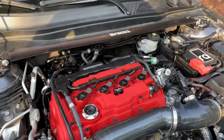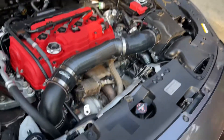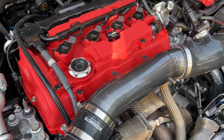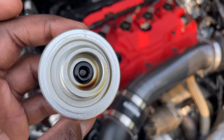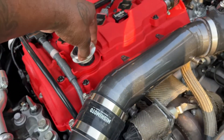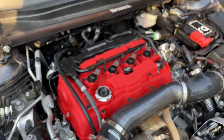I was having some smoking issues from my exhaust. Every time I do a WOT pull or something, as soon as I start letting up, I just see smoke coming out of my exhaust. I thought maybe I had some blow-by on the turbo. But it ended up being — and this is for everybody out here — if you're running a Chasings cap or any cap, I had a Chasings titanium cap. What I didn't do is when I put the new cap on, I wasn't running the gasket. If you don't have a gasket, you're going to get smoke. I could not figure out for the longest time what was going on and why my car was smoking, and it ended up being that gasket. So that's the first thing.